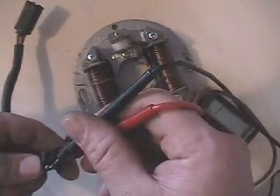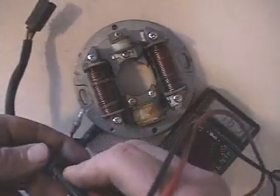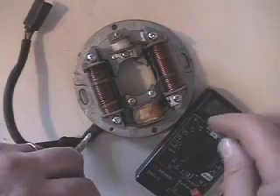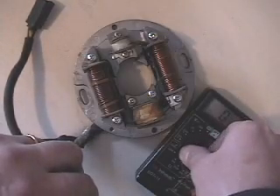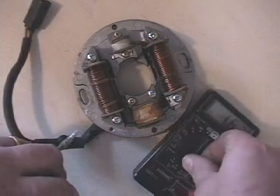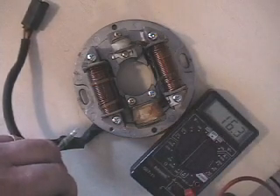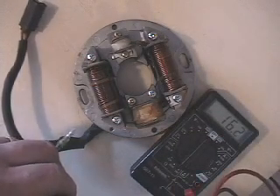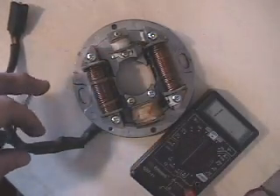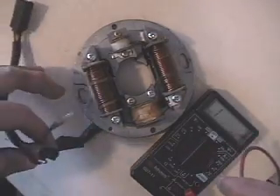And then our two females — that's just the high speed coil, which is roughly 15 or 16 ohms. It says 16. Turn your multimeter down to the next lowest setting and usually it will come down to the 15 range — but 16.3 is fine.